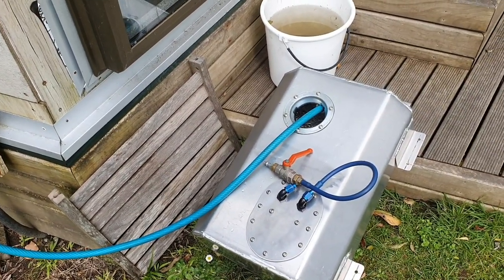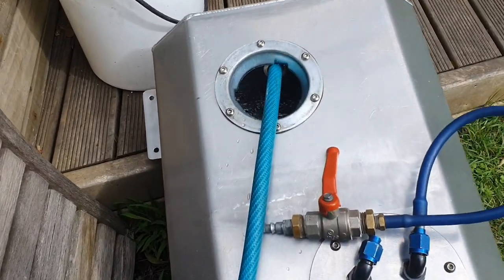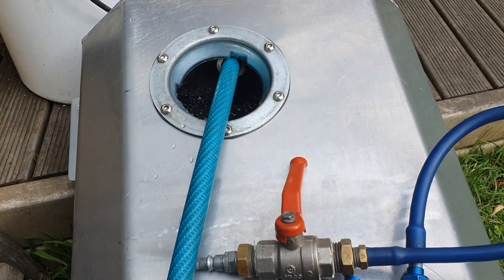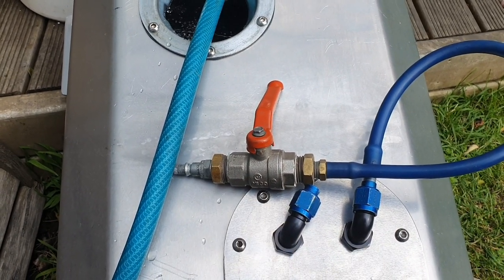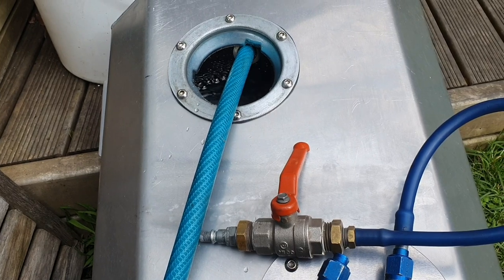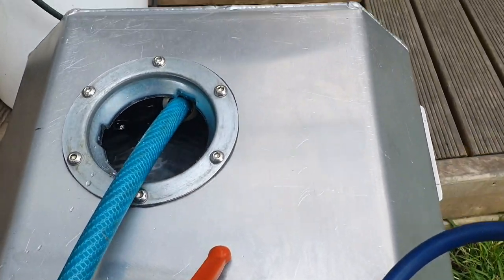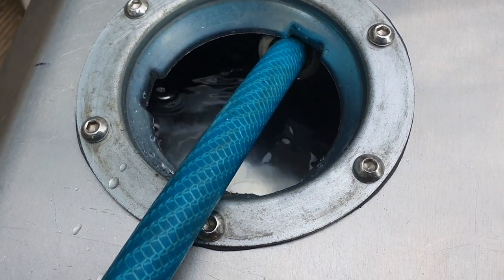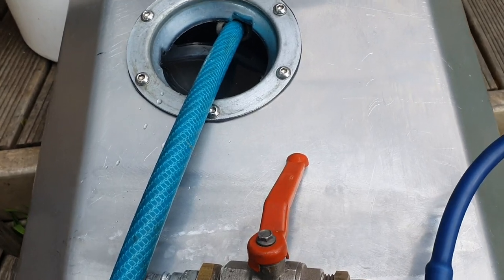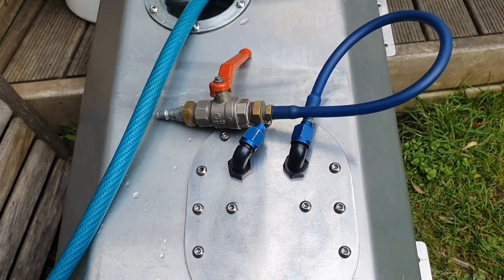Filling the tank with water — kind of the last thing you want to be doing with a tank you're putting E85 in, but it'll be dry long before we put any fuel in. The vent is turned off so we don't fill the hose with water. We're getting there — I'll try to keep the outside dry to make it easier to see any leaks. We'll never be able to fill it a hundred percent once it's in the vehicle because the filler neck comes down below the top of the tank.